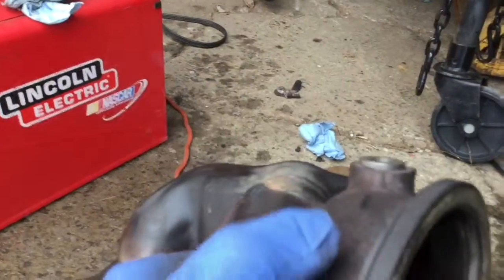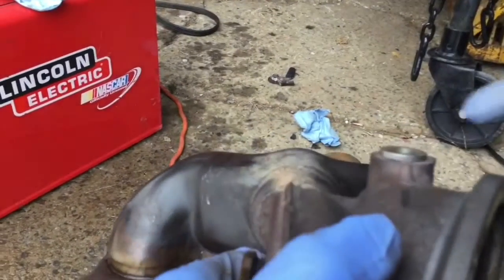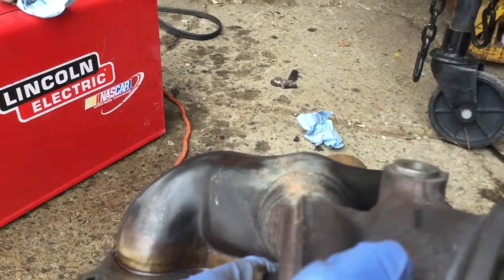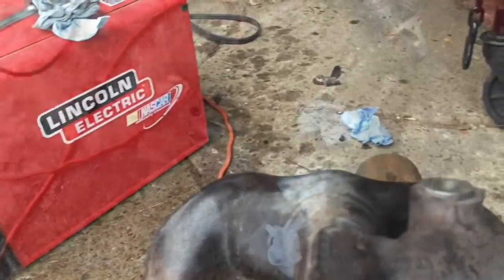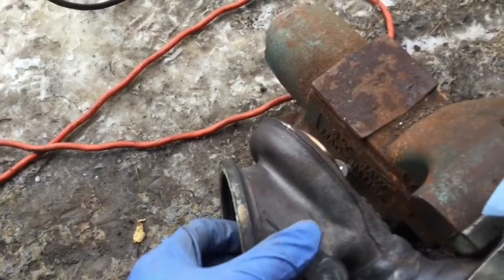Next step is going to be to insert the wastegate from inside and then weld the leverage on the outside once it's at the right position, and this one's going to be done. So same setup with the second one. Just make a line when the wastegate is closed. Closed being, let's flap in.